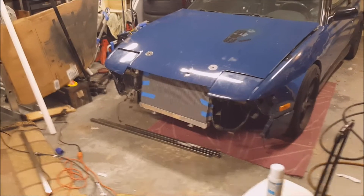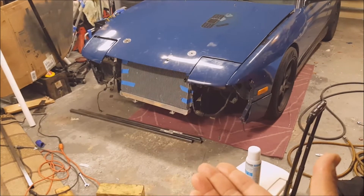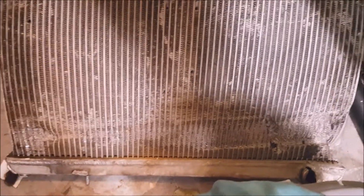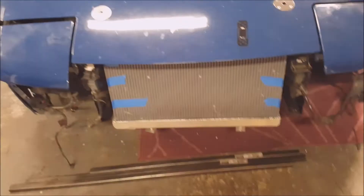Did a real quick test fit. What I want to do eventually is bring the radiator higher than it was — you can see it was sitting down low, and that's how it got taken out. You can actually see the imprint of where the lower radiator support was, that's how low it was sitting. I want to bring it up because if I hit something in the road I don't want it to get taken out. To bring it up I've got to have it sitting at an angle, kind of a v-mount style.